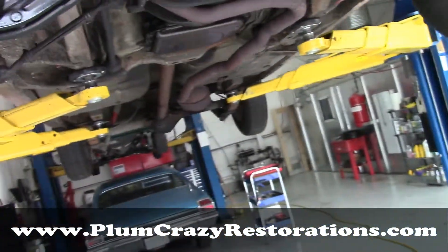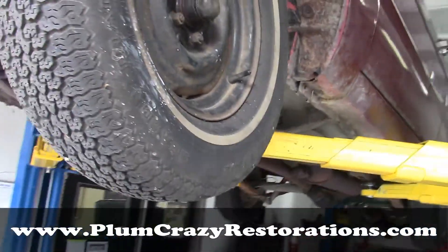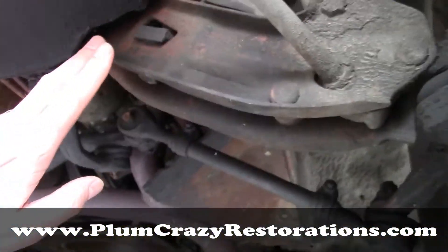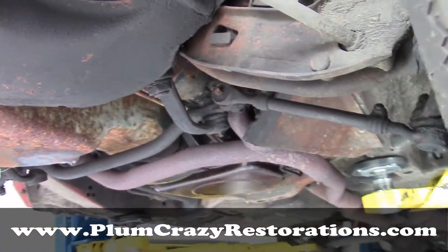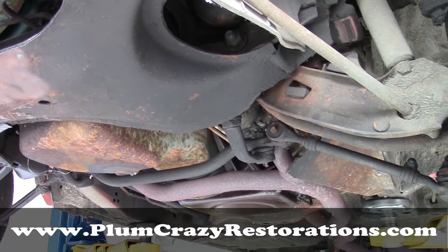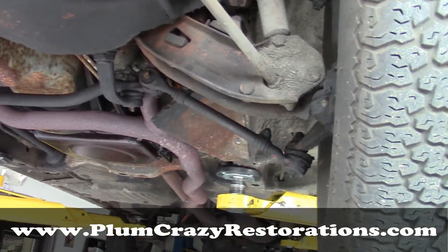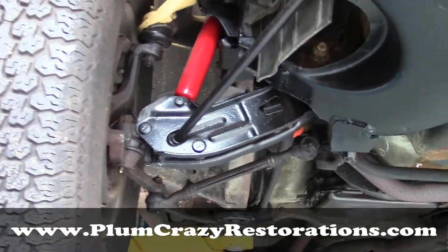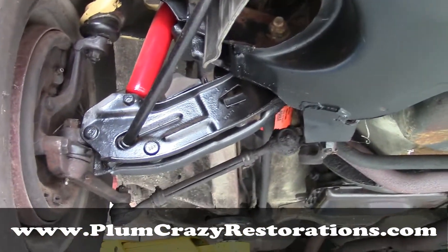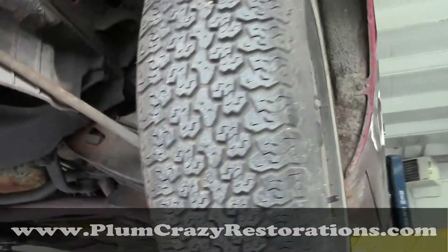There are also some issues with the front fenders. Along with that, the lower control arm bushings on the inside are pretty bad, and we're probably looking at just new bushings, upper and lower. Once we get it up, we'll have a good visual on the ball joints as well and replace as needed.